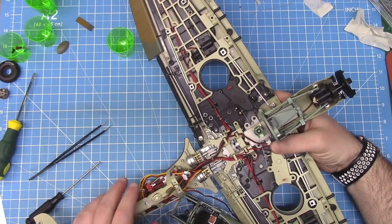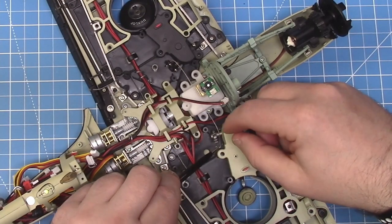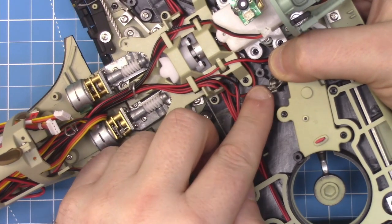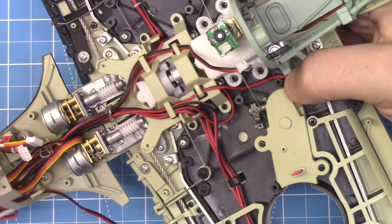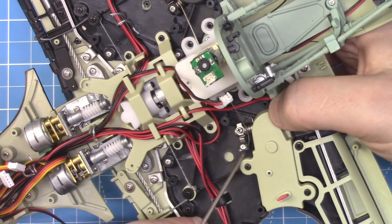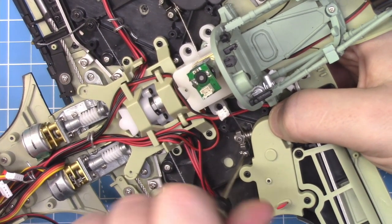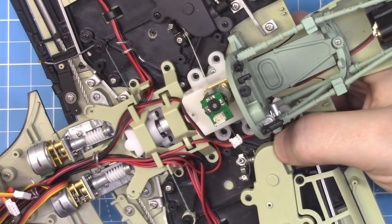That's nice and tight. I'll drop it down again and do the same on the other side — a little bend on the cable just makes it easy to hook into the landing leg. Making sure it's going to hold nice and tight, then I get the screw back in to engage the metal cable. I just don't want to force it out. Put it under a bit of tension when you screw it in — it shouldn't push the cable out. So that's the gearbox back in with the new metal cable.